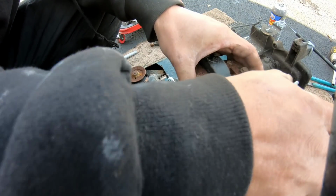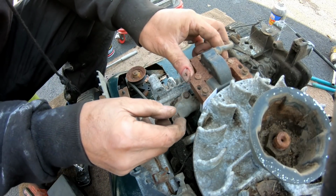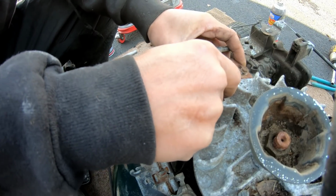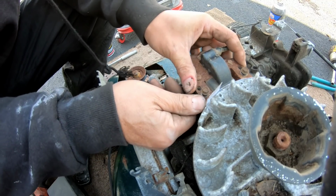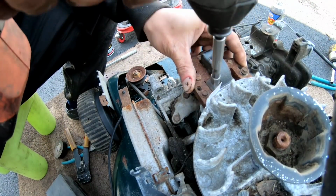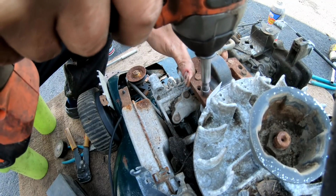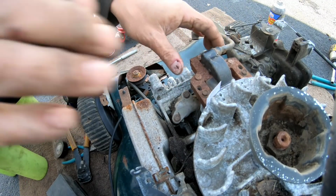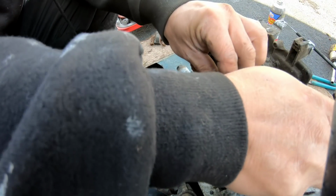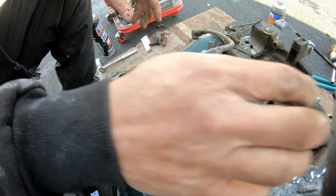So I'm going to turn the magnet to this area here so that the magneto sticks to it, right? You put a business card in here, why? Ten thousandths air gap. A standard business card ought to do it. Give or take a little, it's not the space shuttle, not rocket science. As long as you get it close enough that it's not touching, as close as you can get it without touching. That's it. Can't see, Henry. Well, I gotta get the business card out, don't I? There it is. It's tight.